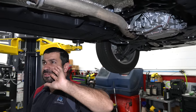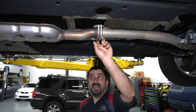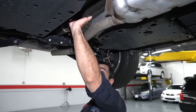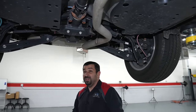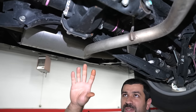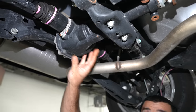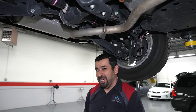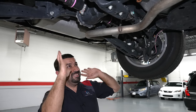The exhaust is typical Subaru — decent quality. It has flex joints rather than flex pipes, which is good. Moving toward the back, you can see the driveshaft going directly from the transmission into the rear differential — not from a transfer case. The rear differential is a small but cast-iron unit, which makes it significantly stronger even though it's compact. This is not designed for heavy rock crawling or towing, but it is as good an all-wheel drive as you'll find in any car of this class.